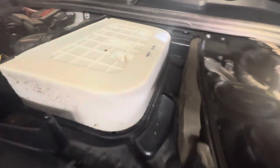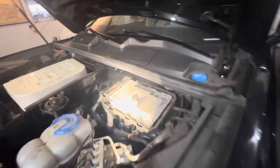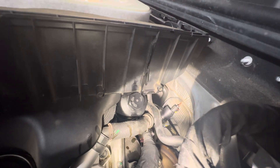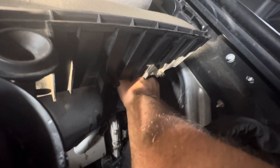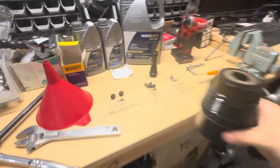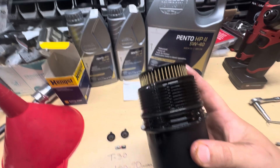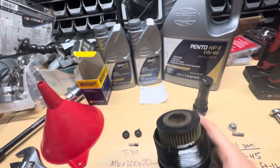It's a good time to look at the air filter and replace it if it needs it — there's a Denso part number, I got it on Amazon. Use your 36 millimeter wrench or socket on the black plastic filter housing. I already have it loose — pull it off and it looks like other Volkswagen Auto Group or BMW filter housings. Pop your filter out, use your pick to remove the O-ring, put your new ones on, and put it back on.